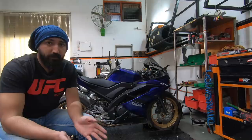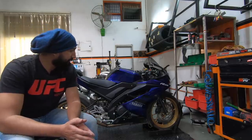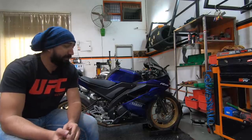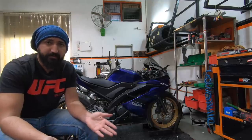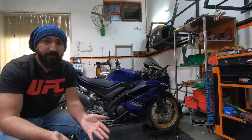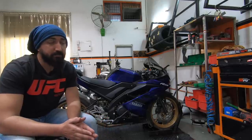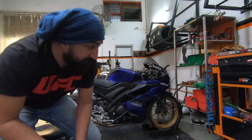So what do we do now? I think what is happening now is that the fueling is a bit too rich right now, so we will keep working on it. So unfortunately, I will not be able to ride this motorcycle today and show it to you. But as I said, this is a process that takes a bit of time and it requires a lot of patience. While that happens, it's not a video in which I will not show you anything. I have something here.